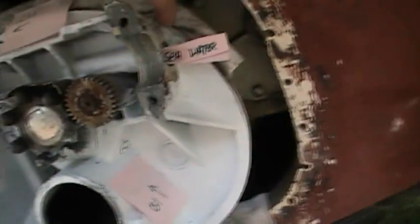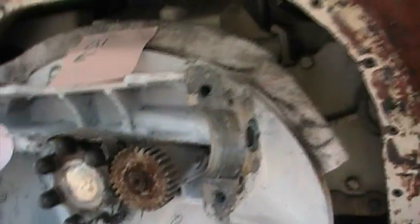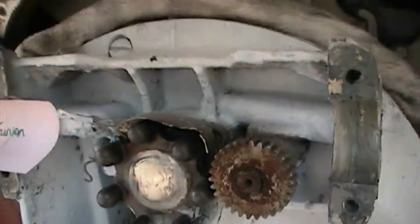I always use a good dose of silicone around it because that's a source of contention for water leaks. Your seawater pump actually enters right here — you can see the label marked seawater. A good place to check your oil is right here; it should be eye level, you should be able to see it. And to fill it up, fill from the bottom — we fill up from right there until we can see it up here.